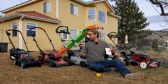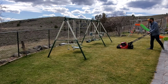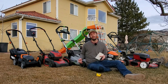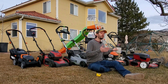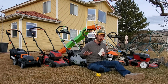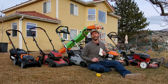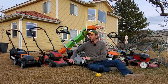These small mowers are fantastic for little tiny yards — they really are, and they're easy to use for just about anybody. My nine-year-old son is planning on using that one with me this coming spring. These big mowers are really great for larger yards. But no matter what size yard you have, as your blade diameter gets bigger the tip speed is going to be faster, which means the lawnmower blade is going to cut that grass cleaner and more efficiently than the smaller ones.